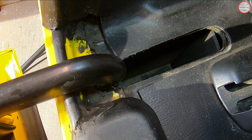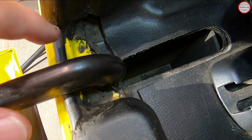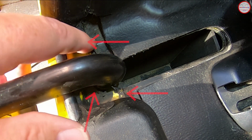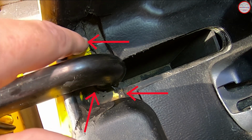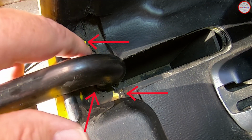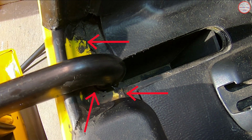And then the last part of this, which is the main part that I found in my 2005 Chevrolet SSR Ricochet Silver SSR, is the bumper fascia itself. The cover comes up to the cargo bed and sits on top of the cargo bed. And what I have found is that the intersection of the bumper cover and the cargo bed seems to be porous enough to allow any water that comes in there to intrude and basically run into the bed.